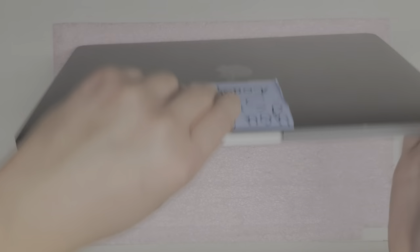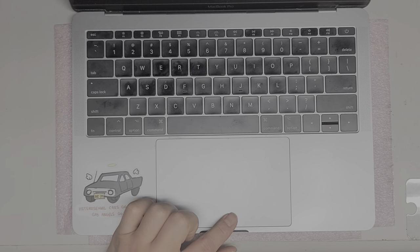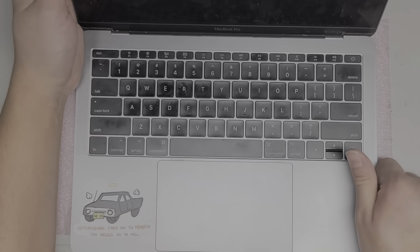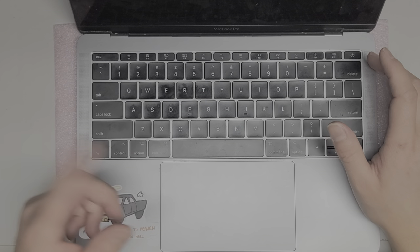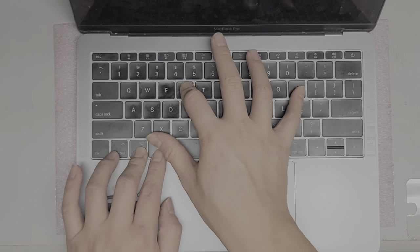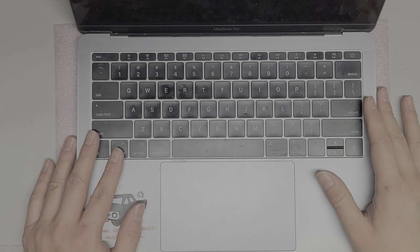Now flip it back over and open it up. It's clicking — if it clicks, that means you don't need to plug it back in and the computer should be starting up soon. Usually after changing out the battery, I like to do a PRAM or SMC reset. The battery is low so I am going to have to plug it in. SMC reset usually doesn't work on these models, but what you do is Control, Option, Shift, and the Power button, and it should power cycle the computer. For a PRAM reset, press the power button while starting up, then press Command, Option, P and R — you should see the screen flash off and flash back on, and then you know you did a PRAM reset properly. That's pretty much it — hopefully this video helped you guys. Please like and subscribe, help others find my videos, and thank you for watching.